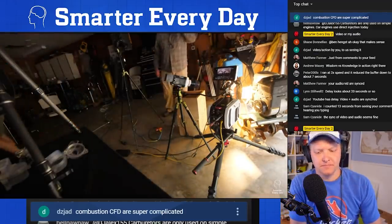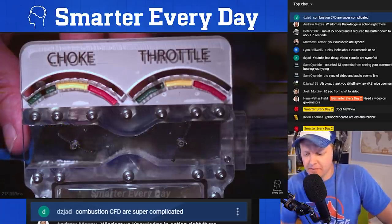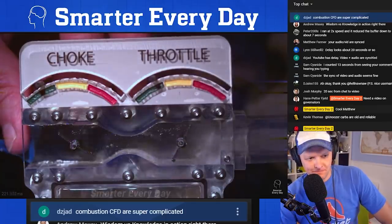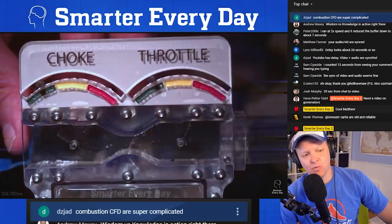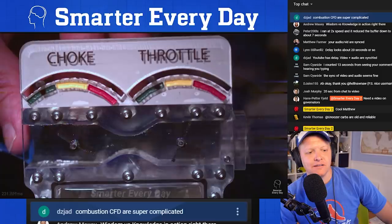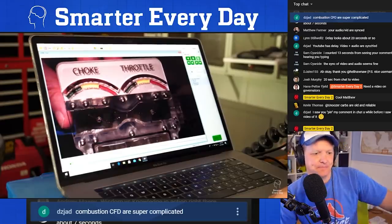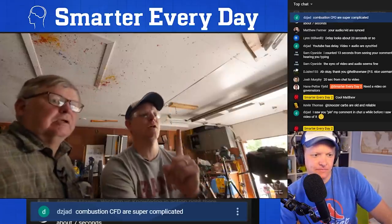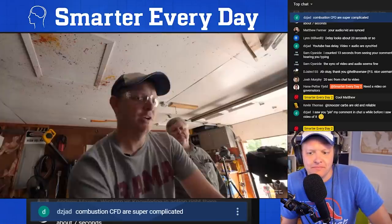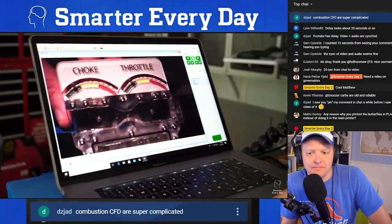Almost killed it. That's a good carburetor. You see the secondary vortices I'm talking about behind the throttle butterfly? It's because of the square edge moving into the intake manifold. So the fuel is coming up into the jet. That's the main jet, right? Yes, it's coming straight up in the middle of the Venturi, and then the intake blows air across it. Look at all the stuff dancing down there. Let's run it again and just look at the top of the fuel in the bowl.